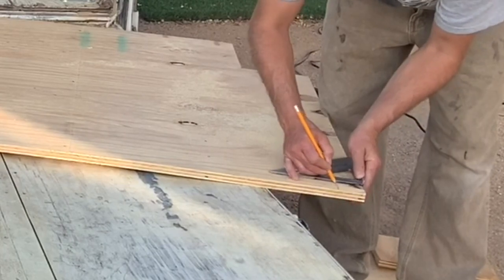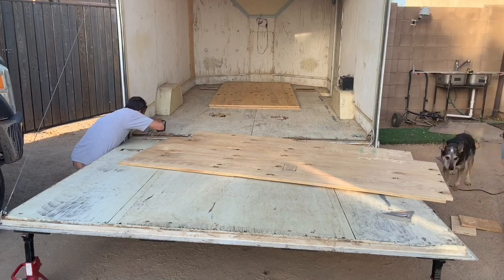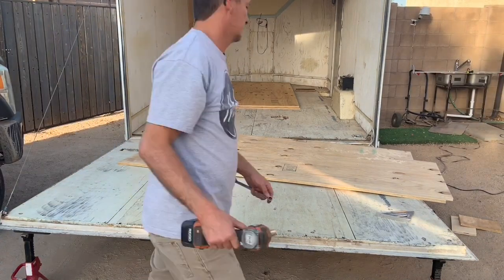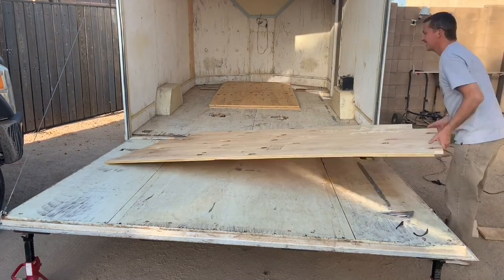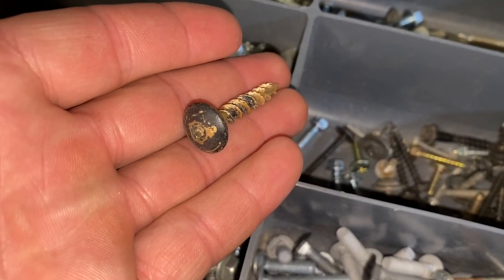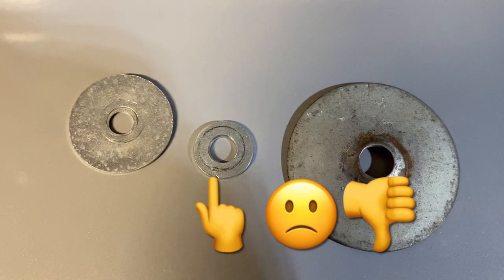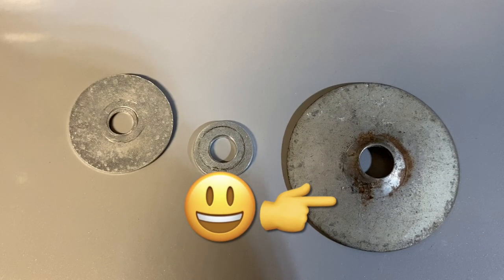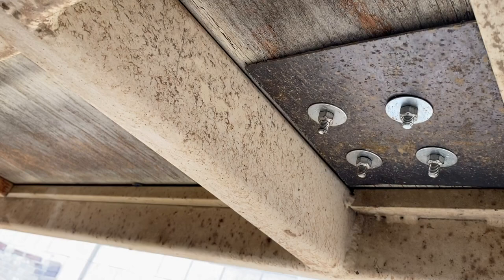Because the lights were in the back door of my trailer I also had a wiring harness I had to notch out so the wires could route around the new wood. I also had to remove the tie-down anchors I had installed in the floor. I learned that the large screws I originally used weren't strong enough — on one trip my sand car ripped two of the four tie-downs out. I upgraded to bolts and fender washers, and I'm going to upgrade further during this project, which I'll cover later in the video.